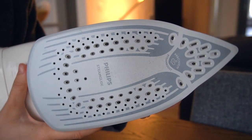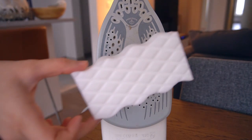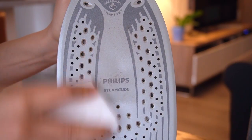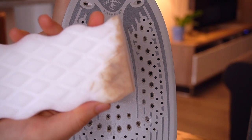Moving on to the sole plate — cleaning burns and marks from your sole plate is very straightforward. The easiest way to do it is with a magic eraser, which I will link below. I love the eraser because nothing goes back into the vents while cleaning the sole plate. After your iron has cooled, simply scrub the sole plate. It works really well and cleans all those burn marks.